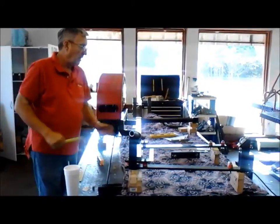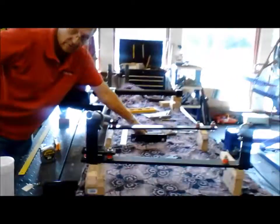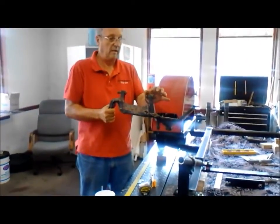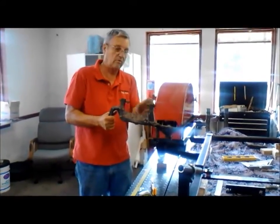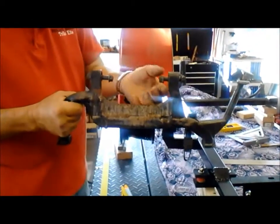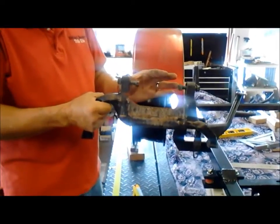On an 1800 Gold Wing, instead of having the center stand where this will fit, the center stand will look something like this and it's attached this way. We also take the center stand off and have a replacement that just bolts right in. You save the bolts when you take them out and put them right back in — the center stand replacement is the same process.